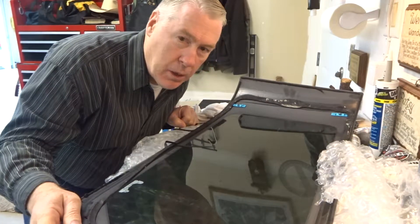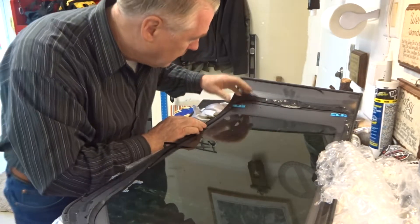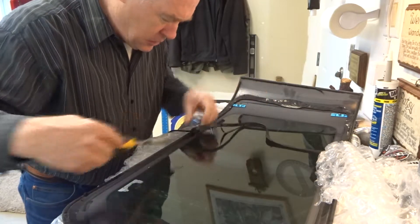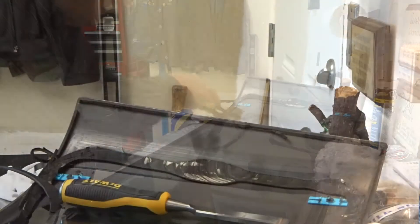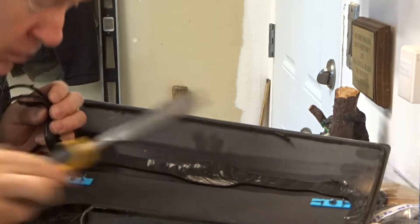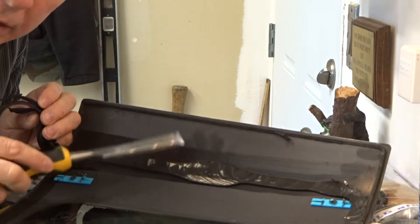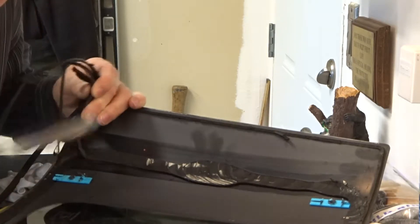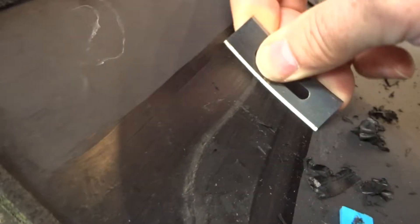This is actually the replacement window that I bought from a wrecking yard. First, what you want to do is remove the old sealant. You can use one of these very sharp tools here and it just peels right off really good. You may have a little more difficulty around the curved area — you don't want to be too jagged, so keep your blade straight as best you can. You can also use a flexible razor blade if you're careful.